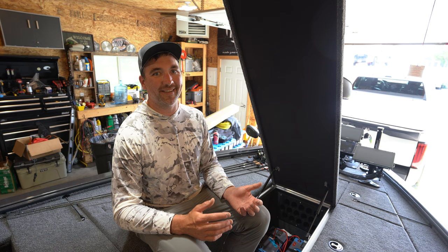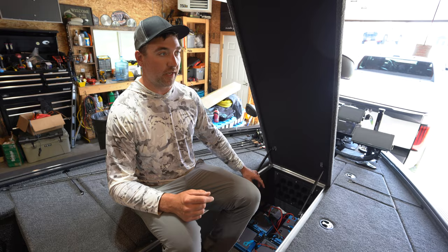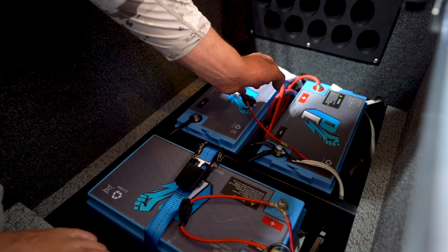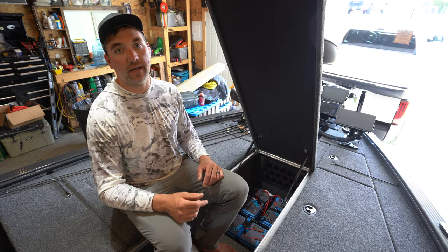They also come in 24-volt if you're running a 24-volt system. But because I'm fishing nationally and competitively and doing 16-hour days on the water at these big tournaments, I've actually got a second 36-volt battery, just in case something happens to one, and to give me that extra amperage. Probably overkill, but that's the setup — two 36-volt Powerhouse 40-amp batteries run parallel to each other. It's still 36-volt and they're tied into the trolling motor, with a charging system I'll get into in a bit.